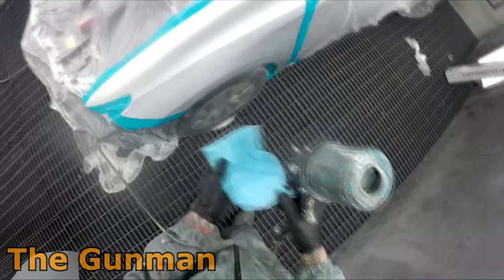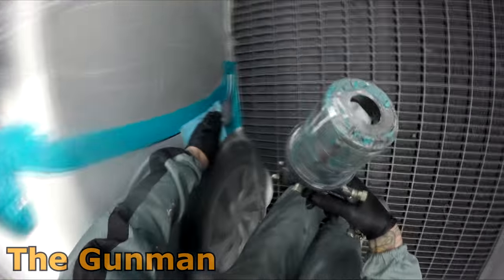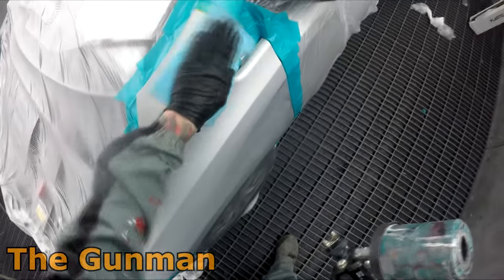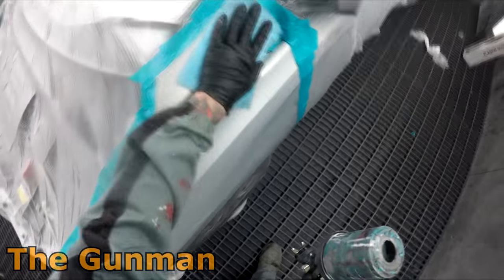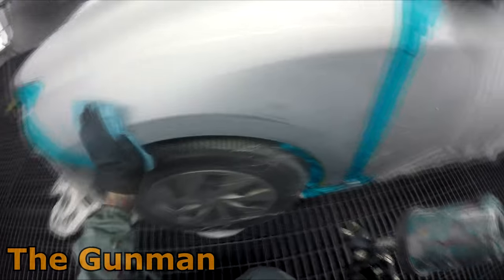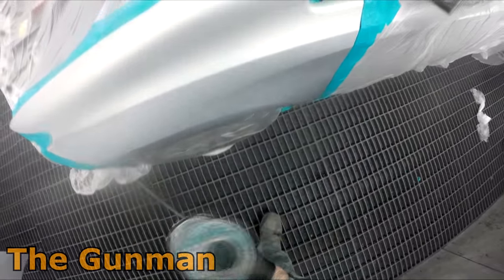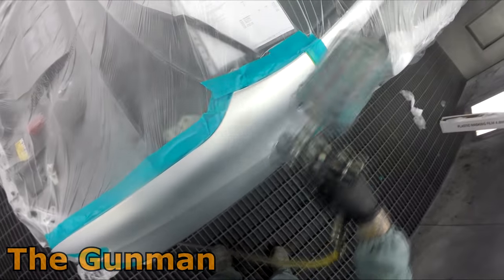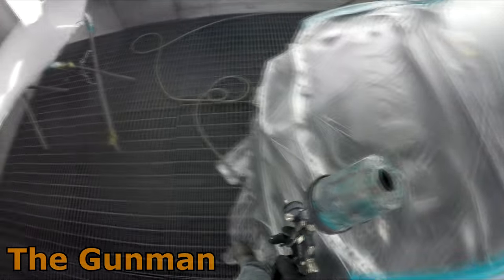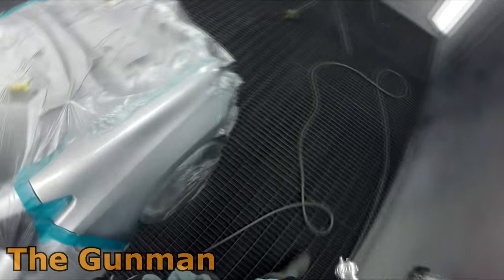You may have noticed I'm tack-ragging even after painting that first guard, because there's probably going to be a slight amount of mist overspray on there and I don't want to paint over that. I'm using the ANI F150 for my base coat blender — this is actually quite an amazing gun. I probably went a little bit harsh on it in the review. It's probably better than any other guns in its price range — it was 150 at the exchange rates when I got it, from Spray Guns Direct.